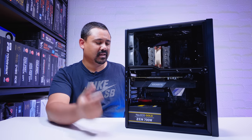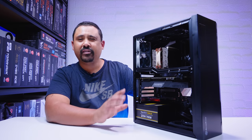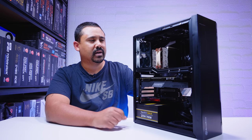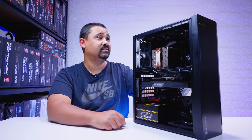And I mean, these things happen. The RAM was just being really weird and I updated the BIOS. It did all the things I needed to do. System runs fine. Thermals are okay. Idles around 43 degrees, gets up to around 70 degrees, which is more than fine for a system like this. I did stress test it, so yeah, it is running quite well.